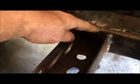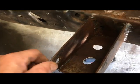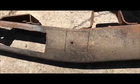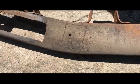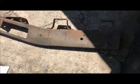Getting the frame cleaned up, and one other thing I wanted to do is box in the top of these engine mounts. Basically just gonna make a piece that goes from the top and angles down so there's still room for the engine mount to fit in there, but it'll give a little bit of extra strength. Using cardboard to make a template to box in the first motor mount on the passenger side, then tracing it onto a piece of scrap steel left over from the C10 trailer.